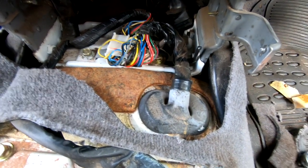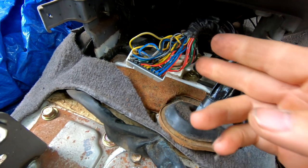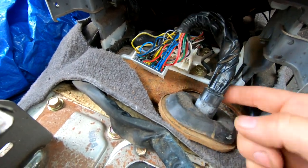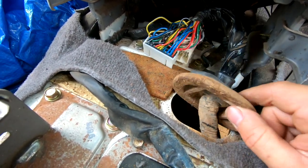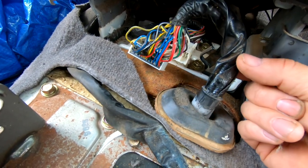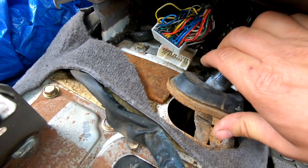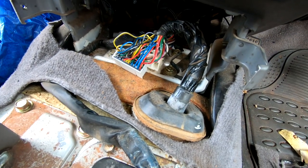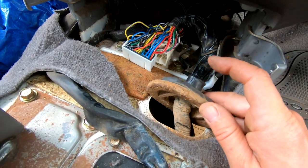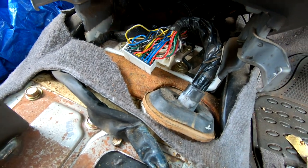Just untape that. To make this easier: unplug the plug right there, pop the grommet out, take the tape off, and then you can literally just pull that upwards. There is a bit of play there — if you're doing a two inch body lift you probably only need to move it an inch; if you're doing a one inch body lift you'll likely get away without doing this. I'm going to slide that up but not tape it yet until the car is all back together.